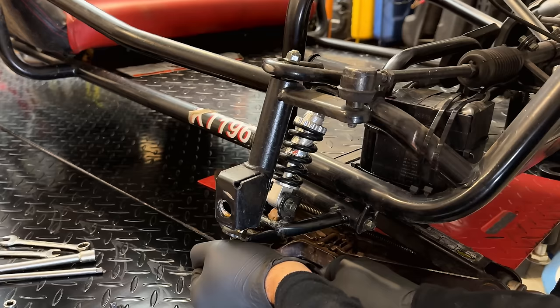It's taken quite a while. So I don't know if this drill bit is maybe done. Or maybe I should have drilled a smaller size first, like get to a 78 and then a 77 before the 76. So let's do that. Let's get the 78 in there. All right, we are through. And that took a lot longer, even with the 78, than I expected. So I'm going to just go one more to the 77, and I think I'll stop there for now. We'll try that out.